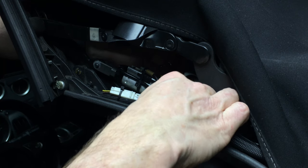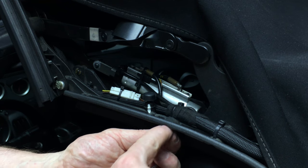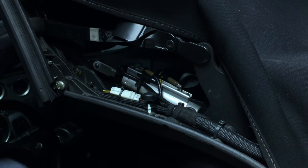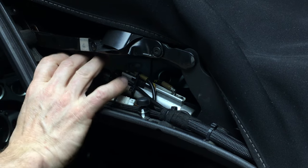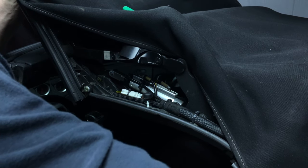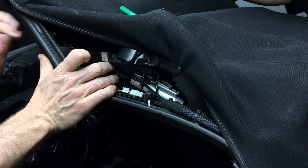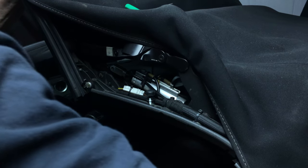Keep pulling. This is why we took the molding piece out — we can take the pin out through this passage hole. Then we extend the bow a little bit, which means we push down the rear bow and the front bow at the same time, and that gives us enough clearance to get the front mounting pin out of the way. We don't want to push too far, so watch out that you don't get your hand caught in this frame coming down. Pin out.